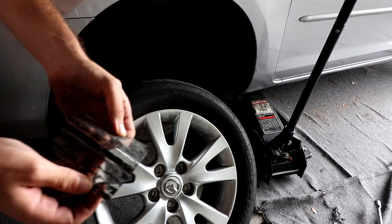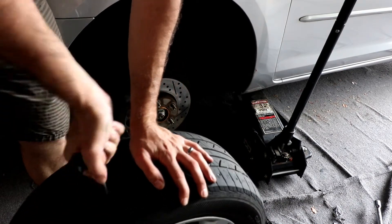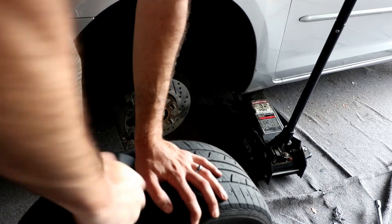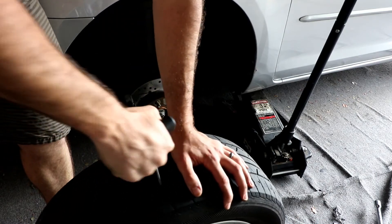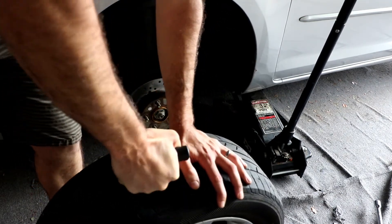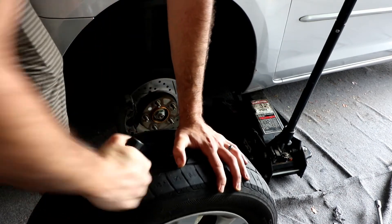The patch is what's going to seal the hole — it's a really gooey, gummy thing. The first tool you're going to use is the reaming tool, which makes the hole as clean as possible. You twist it in, making the hole bigger as well as cleaning it out. You'd think you want the smallest hole possible, but you actually need it to be fairly big to get the patch in there. Twist it around, go up and down, and the hole isn't big enough until this tool can go straight in and out really easily. That's where it needs some muscle.